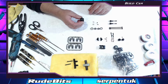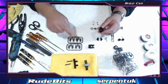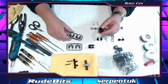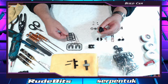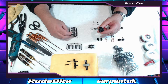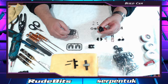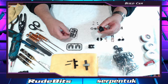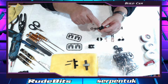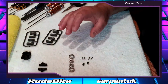So we take a rear hub. Now here we can use any of these inserts, and these inserts, by the way, there's lots of adjustments. They start from 0 and they go up to 0.5, 1, 1.5, 2, 2.5 and 3. So lots of adjustments, and that basically means that we can have adjustments going up and down the hub, right? So if I just go to the cam here, just to show you what I'm chirping on about.